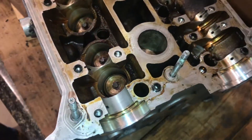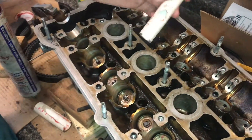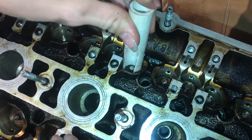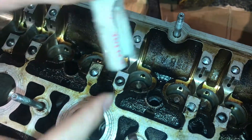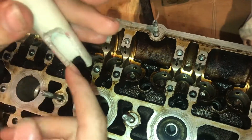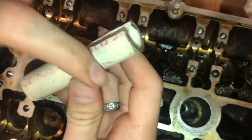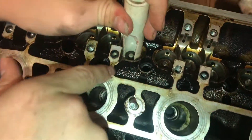These jigs were a lot of trial and error to make. What we had to do was take a PVC pipe and almost cut it down in the center — we had a thinner pipe. You want as much meat as you can get on the pipe itself so that it will sit right on the spring and compress it down evenly. If you cut it right in half, it won't go down straight. It has to be more than halfway, but you still have to have a big enough opening to fit your screwdriver and wiggle the tappets in. It was a lot of trial and error to get the right design. We have this probably three-quarters of the way here, and then a quarter of it cut out. That'll fit right on there and we have just enough room to get the tappet in — that's all you need.